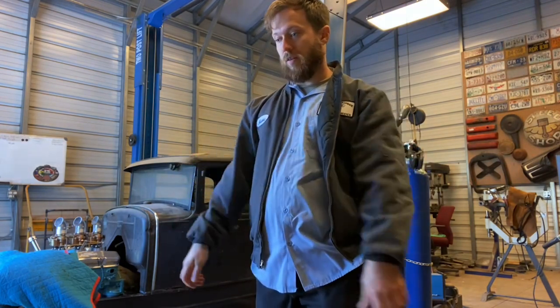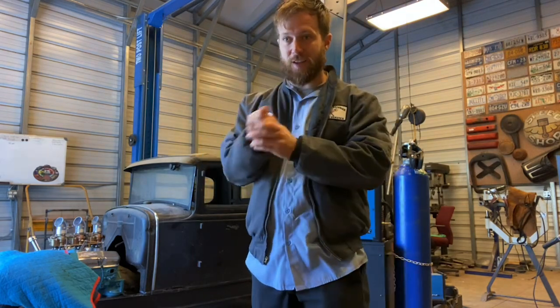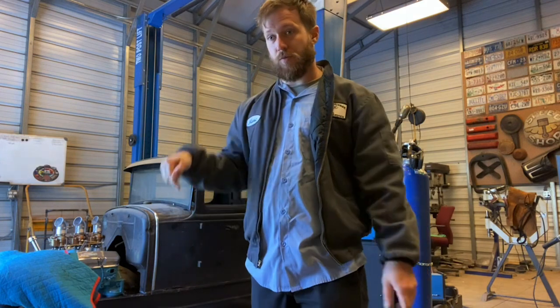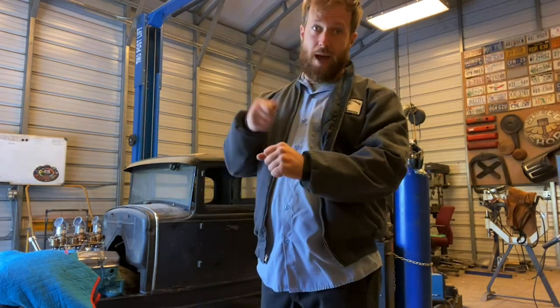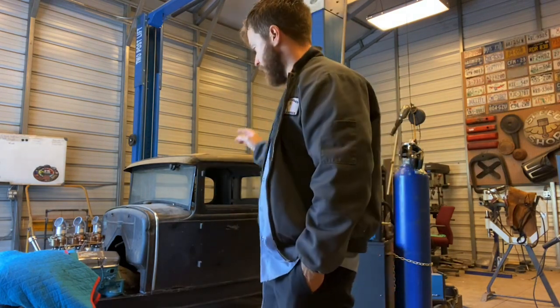I'm gonna take some nuts and lock them together on a screw and then put that on a drill and put that in the vise and then take a grinder, because I don't have a lathe, and just get it up to speed and make them round. Then I'll drill the holes and chamfer the edges, tap them into place, and then I can TIG weld that chamfered edge, and I'll have a nice threaded piece in the frame. So, gonna do that.